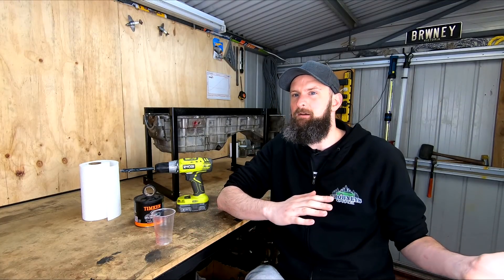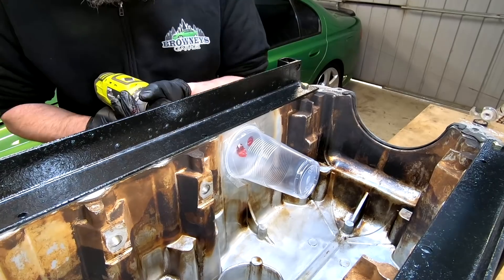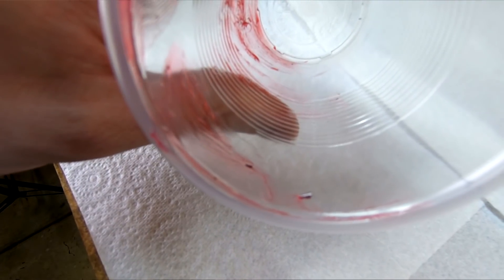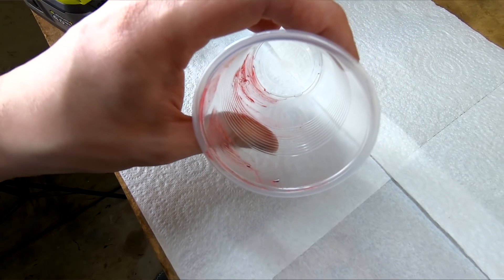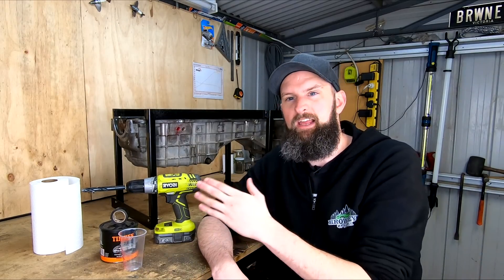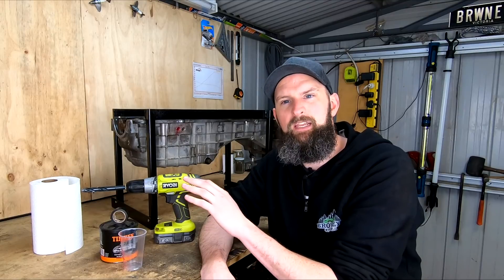Okay, let's pause it there - I don't normally do this, but I'm editing this video a few days later. I wasn't happy to leave it there, so I went back out to try again with a slower drill speed. I taped the drill bit so it couldn't go too far through, and made sure a heap of grease was used with a lot of breaks to clean it. Thankfully the results were a lot better - there was one medium and one small piece caught in our grease along with a very small amount of fine material. Further testing from here was filmed earlier before I re-ran this test and so it's based on results with a lot more debris - more of a worst case scenario. I'm quite relieved it can be done a lot cleaner.